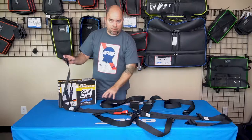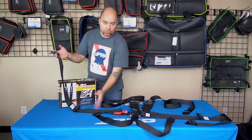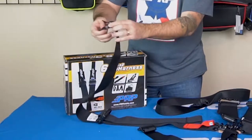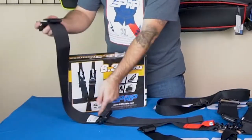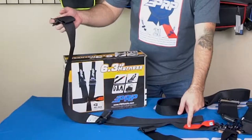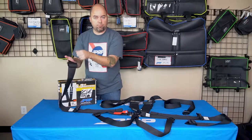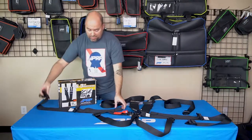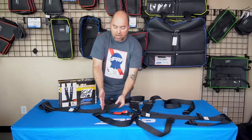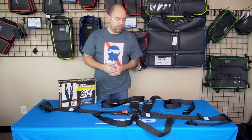On the lap belts, what we previously did to make them pull up is we asked you for a measurement to let us know where we would put the adjuster. Now you don't have to do any of that anymore with this belt. It has an adjuster here, so you can clip it in where you want it and adjust the length to change the distance of the adjuster. You can have it right by your buckle, you can have it outside the seat — whatever you like. After you adjust it, just trim off the excess, burn it so it doesn't unravel, and you're good to go. You'll have a perfect setup belt just for your race car.